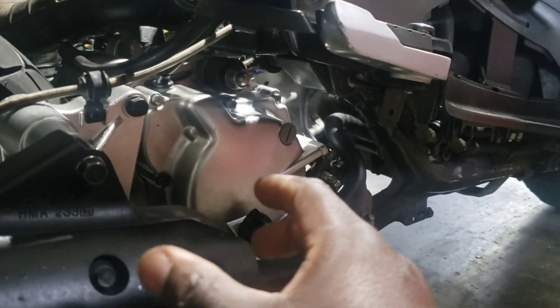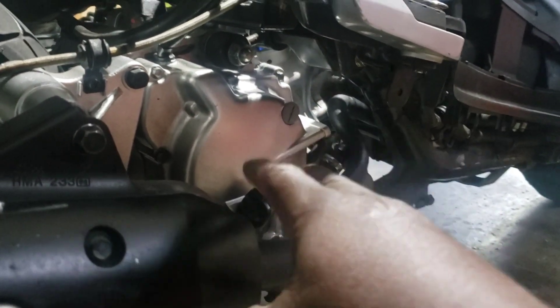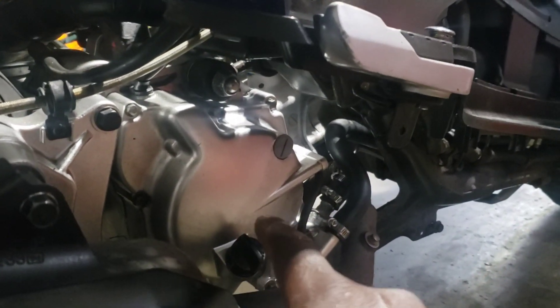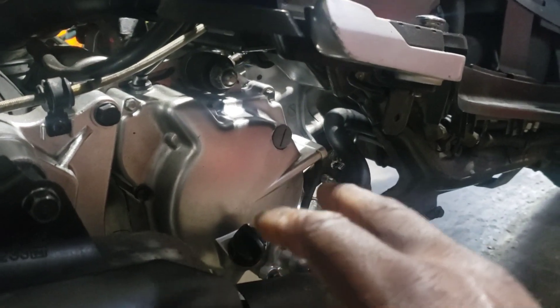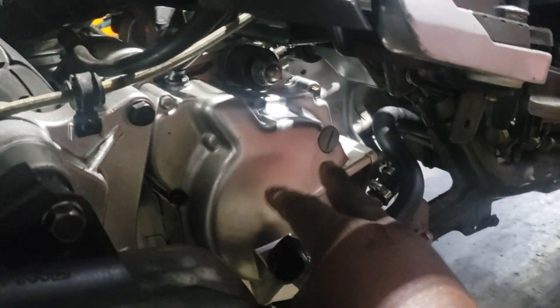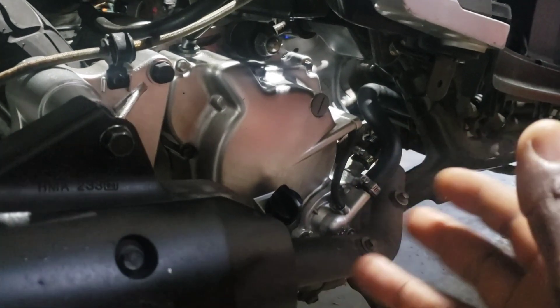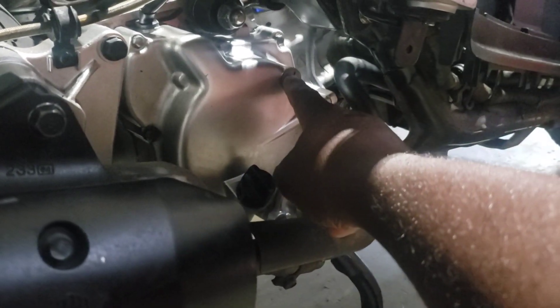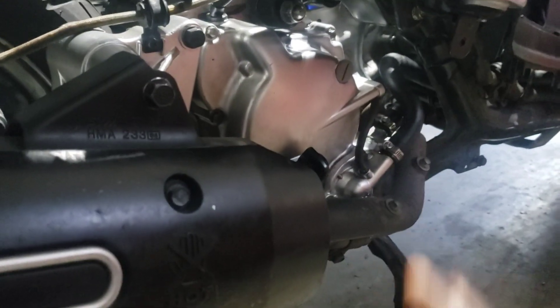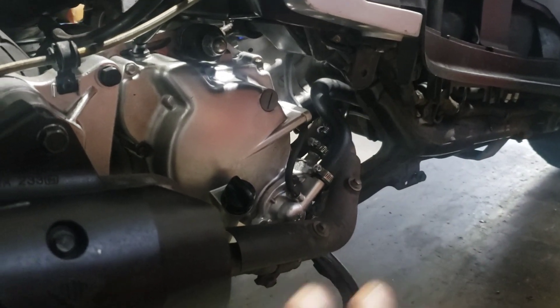The flywheel had not been torqued down by me — I didn't have a long enough socket, but I finally got one and got it on there. In the process of the flywheel not being on there tight, I broke the keyway. There's a keyway that holds the flywheel onto the crank to keep the flywheel in place, so when you're doing your timing it's in the right position. Otherwise it was just free spinning. The flywheel helps with balancing and when you do your timing and take this off, you know you're at top dead center.